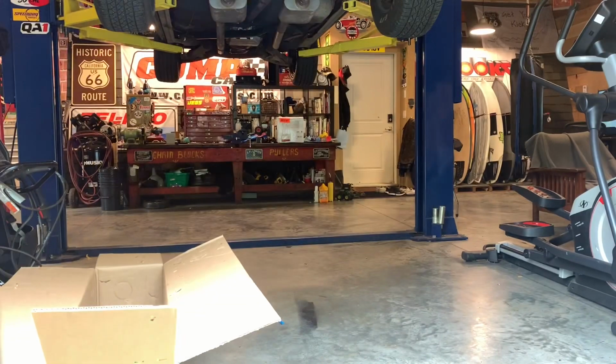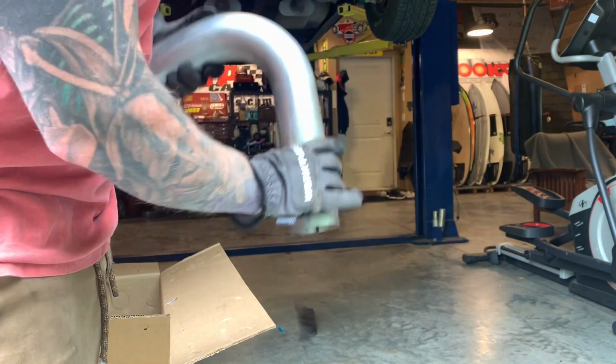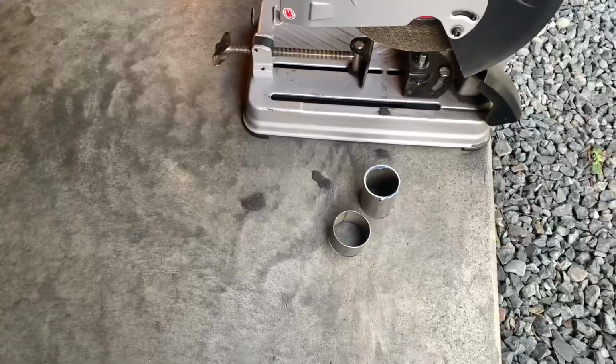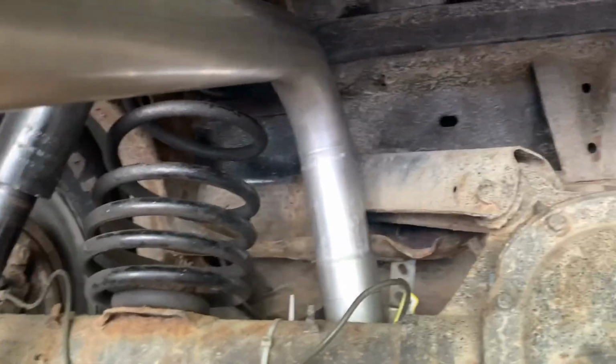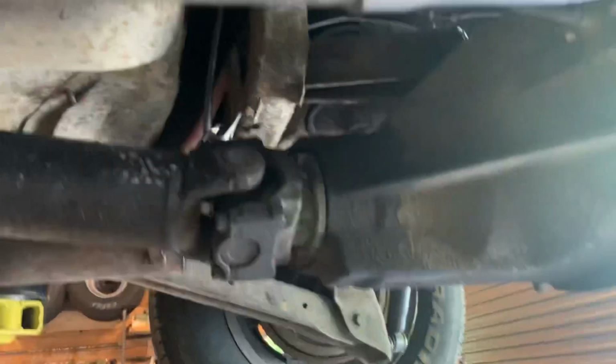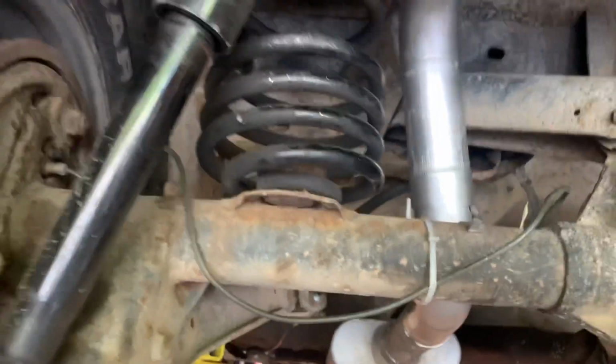And then I'm gonna have to cut the upward section of that pipe as well, so that this will slide onto it and make the turn up top. So many cuts and measurements later. Measurements meaning just jamming things on and turning them, trying to figure it out. This is sort of the basic over the axle setup. So I had to cut enough out of the slip so that it'll still go on there and I can clamp it. Cut some out of this slip too, so it would bring the height of the turn down. And then you can see kind of what I'm dealing with.